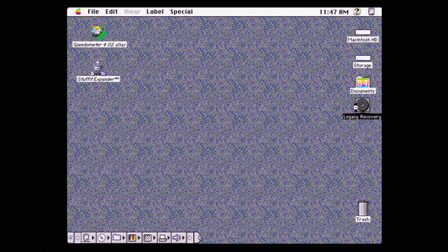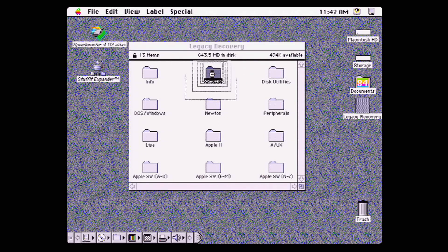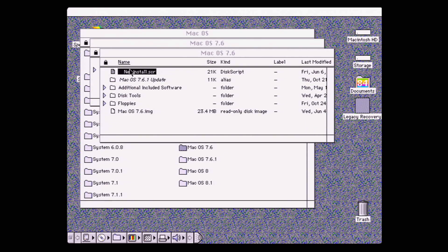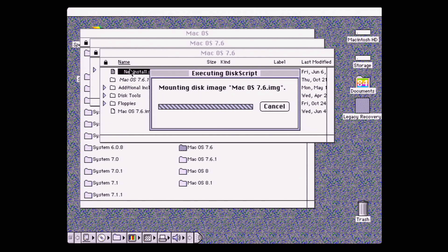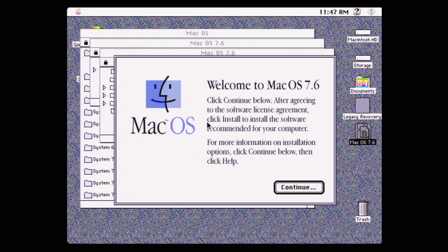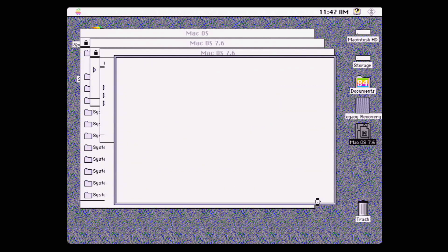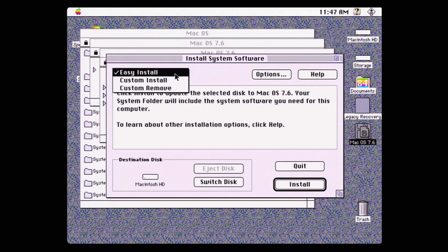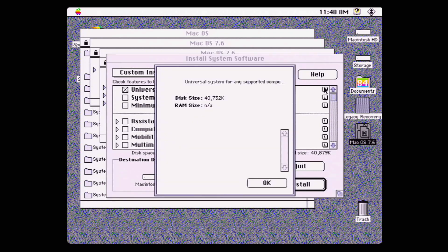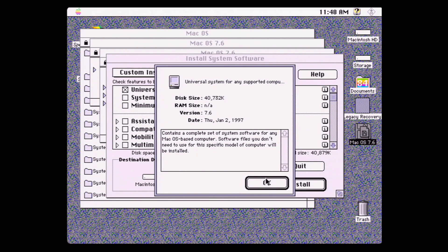Apparently you need software, but it's not as simple as just installing drivers — at least not just yet. The Macintosh system software on your system must be updated to take advantage of the PowerPC processor, because the version of macOS installed is likely only designed to work with the Motorola 68000 series processor. So unless you specifically installed a universal version of macOS, you need to update it. Thankfully, this doesn't require erasing your entire system. All you need to do is run the System 7.5 or later installer — in this example we're using System 7.6. From the installer, select the custom install option, then select the option for any Macintosh or universal system. This will ensure that both 68k and PowerPC components are installed on your hard drive. Then select install and your Macintosh will be updated with the appropriate software.